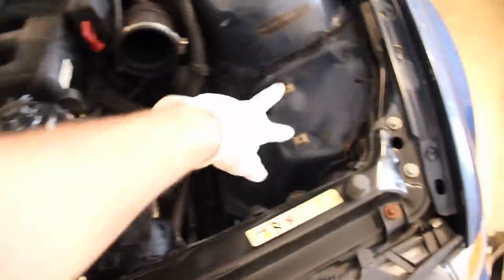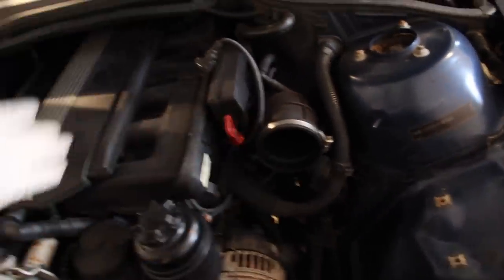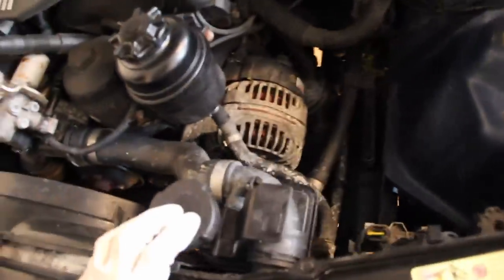So I've got the box out of here — two 10mms, and the hook pulls straight up. It's a good opportunity to clean all this stuff up. If you've got moisture in there from issues with your cooling system, that's bad. You don't want that getting into your filter, soiling your mass airflow meter, and potentially getting into the intake system.